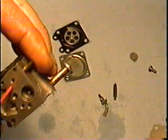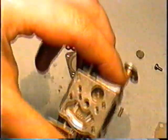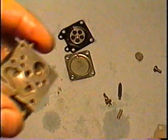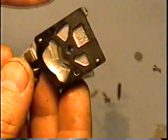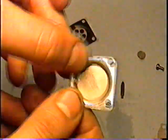I'm going to spray everything — all the holes, even in here — and you should see gas coming out of another hole. This carburetor is clean so I'm not going to do too much, but make sure everything is clean. You can run a little wire in here. I'm going to spray where the needle goes and you should see gas coming out the other side. Make sure all the crevices in here are clean — sometimes there will be dirt or varnished gas. Also this thing here — you want to make sure that's clean.